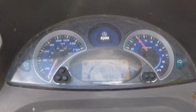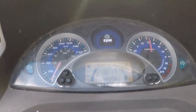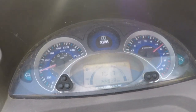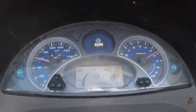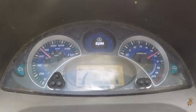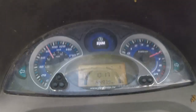But first let's take it for a test run. You can see the clutch working at 3800 rounds per minute, and after the clutch is fully activated you can see the engine working at 5800 rounds per minute. That is way too low since the engine is constructed to work at 7500.